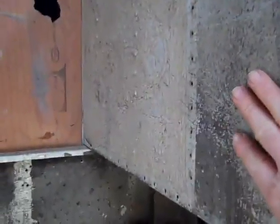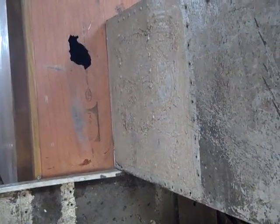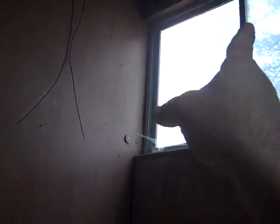They mounted these arms on here and used some Mickey Mouse struts, and when everything broke it damaged everything in here. It cracked and broke this, split and broke this back here. So all this from this point back, top and bottom, all has to come out. Then we'll put a big piece of aluminum in here, mount it to the piece underneath and through, make it very strong. Then we'll get new pieces of this, either the same height or taller depending on how the engine is going to sit.